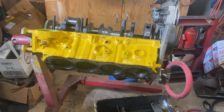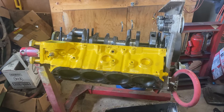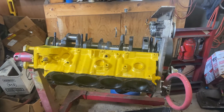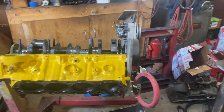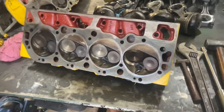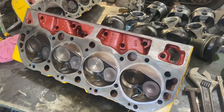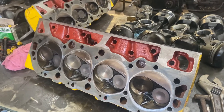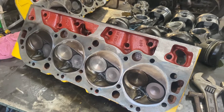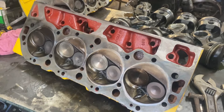I'm not going to rely on these side mounts. The block's zero deck, so by the time I take the receiver grooves out, I'm going to be 20-25 thousandths out of the hole. That's not any good. So I guess I'm looking for a block. I really don't want to put receiver grooves in these heads, because that will basically ruin those heads for anybody that wants them in a street application. Copper gaskets and fire rings aren't needed until you're supercharged on alcohol and whatnot, so these heads would be devalued if they were receiver grooved for copper gaskets.